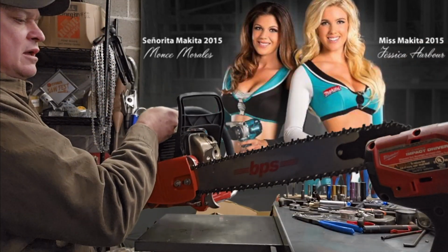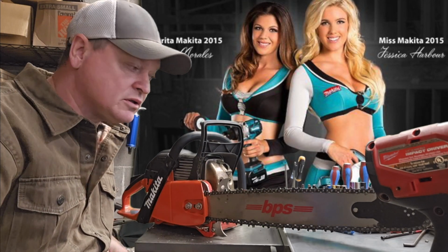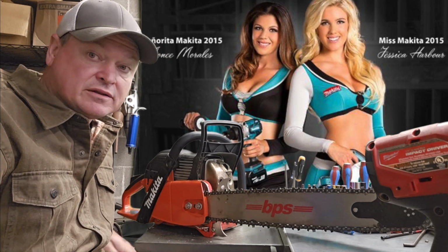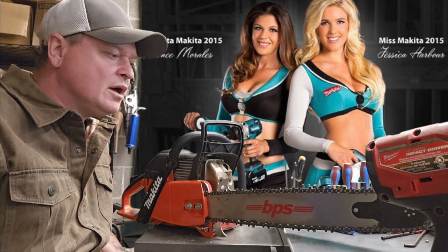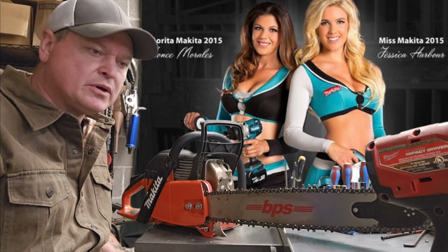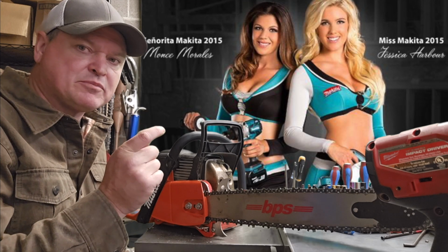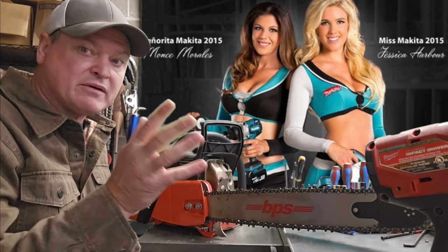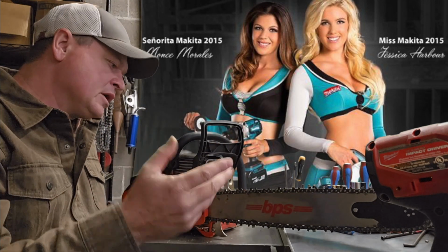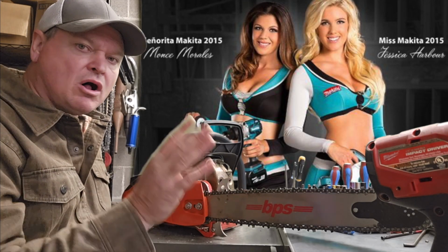So it does take a Husqvarna small mount bar, right? Which is nice because most everything takes the Husqvarna pattern bars except for Stihl. You know, Stihl likes to be proprietary, and they have their own bar mount setup, which is fine. You can take that and get an adapter for the Stihl bars and make them work on about every single thing there is. So the Stihl bars are really nice and everything, but if you don't want to do an adapter, Husky bars are readily available in all different makes.